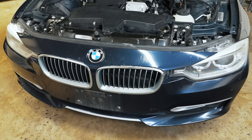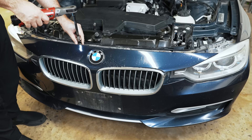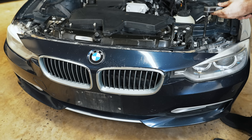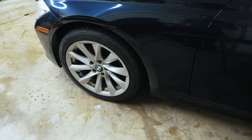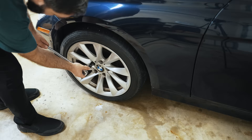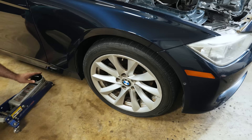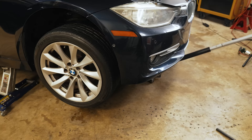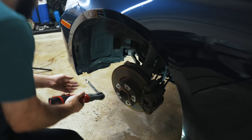It's recommended to remove the front license plate cover because the screws can go deep enough that they attach to the crash foam. You're going to remove this rubber seal up at the top of the bumper. There are some T30 Torx up at the top, and in the corner there are T20s. Then it'll pull forward out of these metal clips up here. Given the headlights are coming out, I want to get the car jacked up, get the wheels off, take out the wheel liner, and go after all these 8mm bolts.